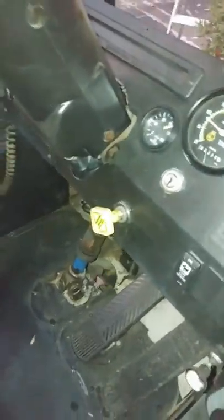This is the back of the starter solenoid right here. We had this purple wire coming right here to the middle of the starter solenoid. That was what was sending a signal to the actual starter itself, telling it that it's okay to turn on.